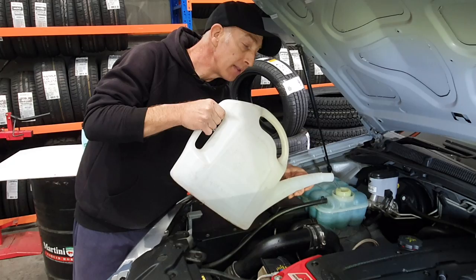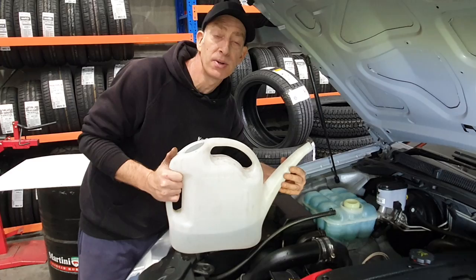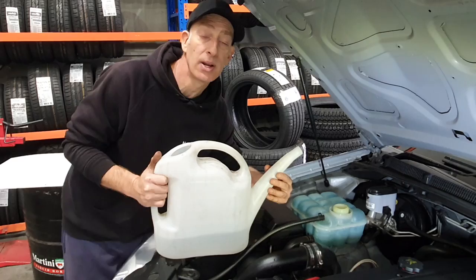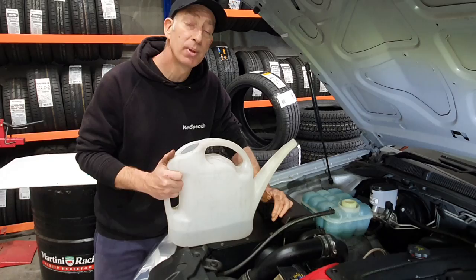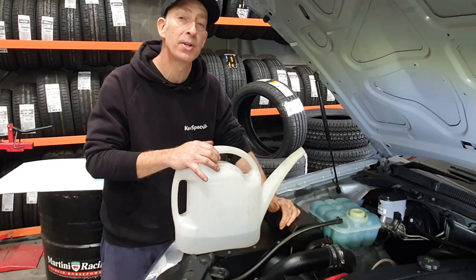Some modern Mercedes have multiple water pumps — some new cars have three water pumps, an electric auxiliary pump, a primary pump, and other pumps for the heating system — so you can't always get the air out by letting it rise naturally. I highly recommend if you've got Euro cars or Mercedes or any other vehicle you're not sure about and you're having trouble bleeding, ask a professional and maybe use a proper vacuum bleed and refill kit. And if you ever need a cooling system bleed, come and see the guys at Grease Monkey Auto Works — they use Martini racing products and can handle your cooling system 100%.